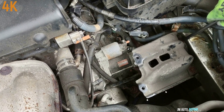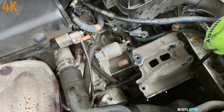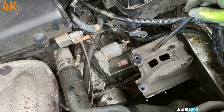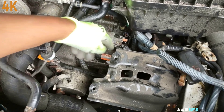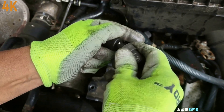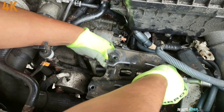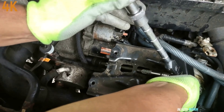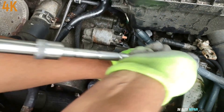This one can come out but this one is rusted — the head of the bolt cannot be grabbed with a 12 millimeter anymore. It seems like it's gonna break, so I don't want to take chances. I'll leave it and take it out like this. There's a 14 millimeter bolt here, one here, and another one here. I'm gonna be removing the adapter here.